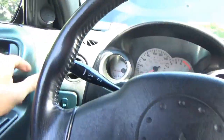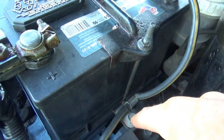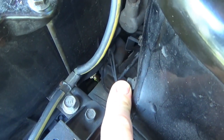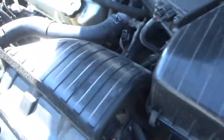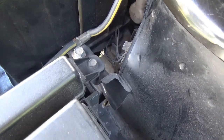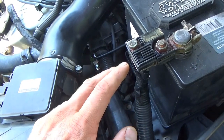We got one cable here, there's a crimp, there's a body ground. We've got a whole bunch of grounds right here and this is not doing well. I assume this goes down to our engine. So let's try to get the car to act up — we could put a voltmeter on, reference at the battery ground, and put the other lead on the cable. Voltage drop between the engine and the battery itself — see if that could cause a problem.